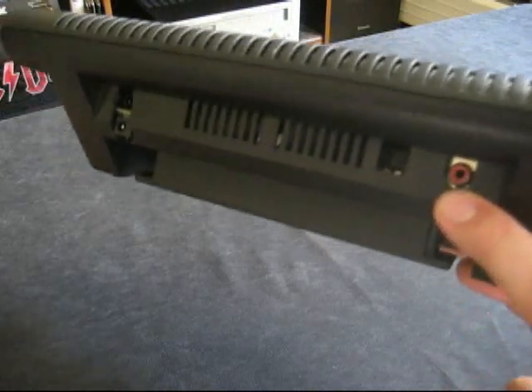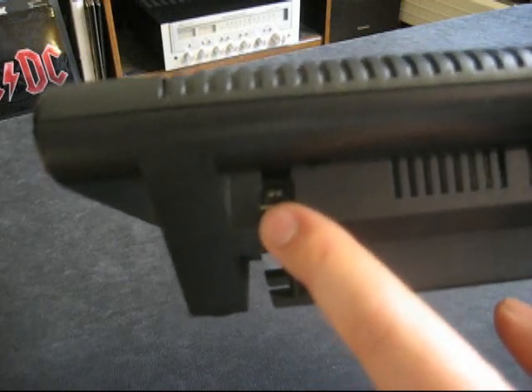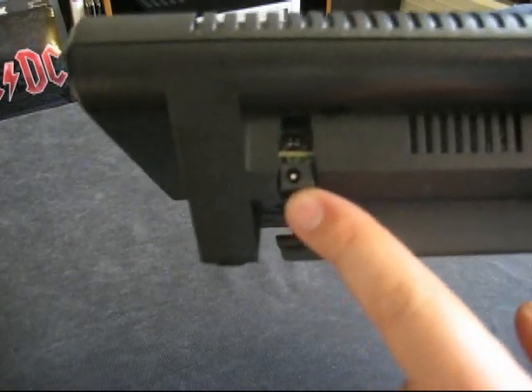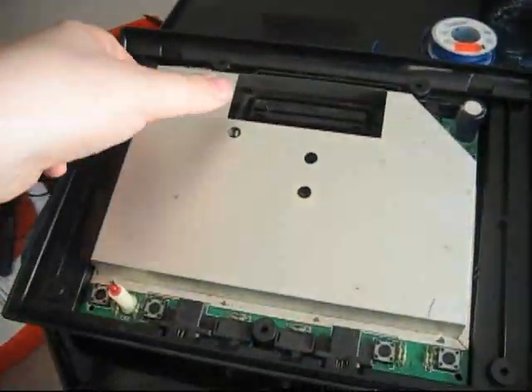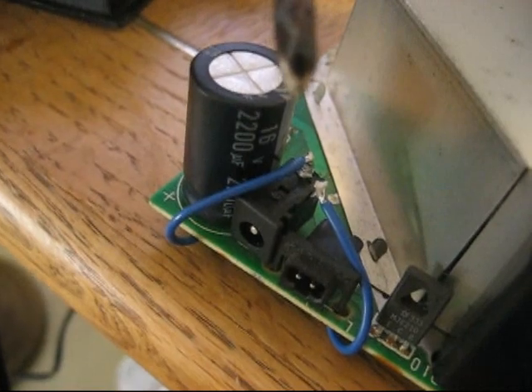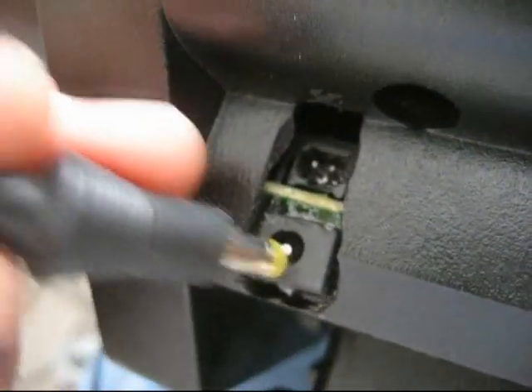Here's the RF output on the back, and here's the standard two-prong — it's a little square connection with two pins in it. Unfortunately I didn't get the power supply with mine, and I've modded mine to take a standard Sega Genesis power adapter. I picked this system up really cheap — $10 — and I knew that finding the power supply would be next to impossible because of that two-pin square design. So finding one would probably cost more than the system's worth. So I modded it with a Sega Genesis jack and now it works with any Sega Genesis power adapter, which is easy to find and I have lots of them.